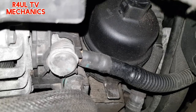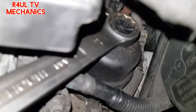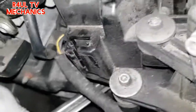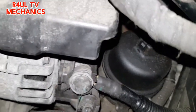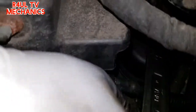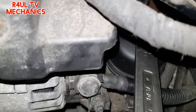You can see it there. It'll most likely be a 27 or 24mm spanner — we'll get that on and take it off. I've got the 27mm spanner onto the oil filter there, as you can see. We'll go anti-clockwise; as soon as we crack it we should be able to take it off with our fingers. There we go, that's cracked. The filter is still tight so I'm still giving it more — just turn it. It's a slow process but not the hardest one in the world. If you've got a shorter 27mm, much easier. Anti-clockwise, let's take that off.